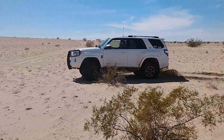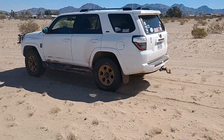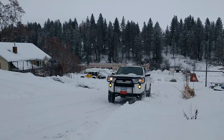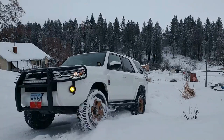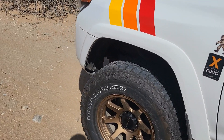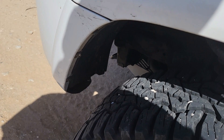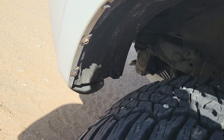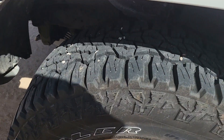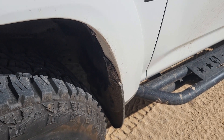Phenomenal in the snow, the sand - they just bite very well everywhere. I've got the Vision rims on there in a 17x9, negative 12 offset. Love the look, love the stance. But they do rub. I had to move that out and do quite a bit of trimming, and I actually moved the fender liner in - used a heat gun to melt it in. And it still rubs just a little.